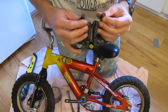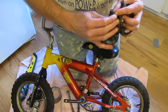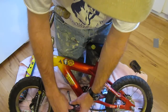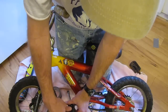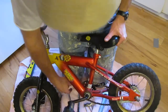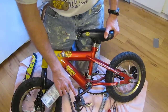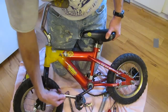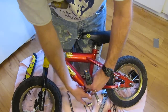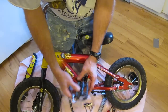On the end of the pedal axle is stamped an L and an R for left and right. This appears to be the left pedal — to install it, you turn it counterclockwise and it should thread on mostly with your fingers. To take it off, if it won't budge because it's rusted, spray Liquid Wrench right where the pedal meets the crank. Then take your 15-millimeter wrench, turn it clockwise to remove the left pedal. That's the direction that would normally tighten a standard bolt, but here it loosens the pedal, and it comes off.